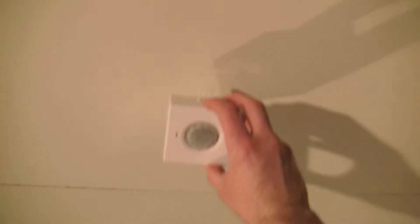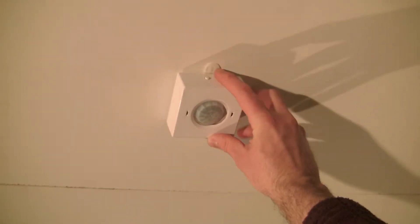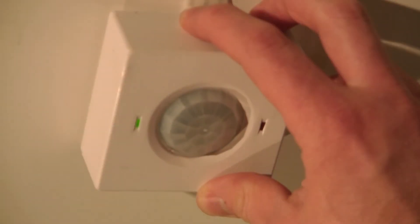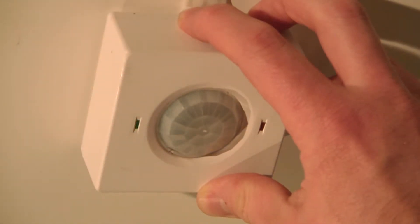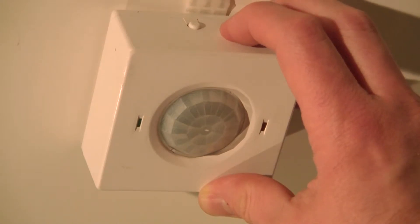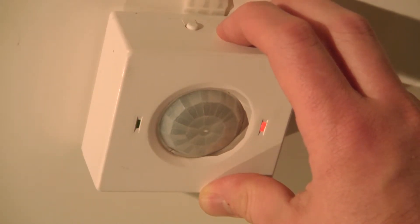Step 5. Once you have found an acceptable location, press the button on the DataLogger and hold it for 10 seconds. Use a small pen or paper clip if your DataLogger has a recessed button. The green LED will flash rapidly. While this happens, press the button 3 more times in succession, at which point both the orange and green LED will begin alternately flashing.